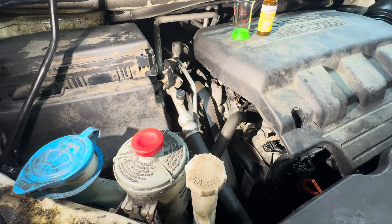I'm trying to figure out where it's coming from. The cool thing with these power steering pumps is you can buy just about any part you need for them from Honda. So if you've got a little bit of mechanical aptitude, you can get the seal or gasket that you need, pull it off and replace it. First thing I want to do is isolate which seal or gasket it is and go from there.